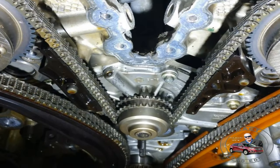We had no lead and we had no tin. So overall, there was no damage to the bearings or to anything else that was on that engine as far as the needed stuff. This metal came directly from the water pump, and I'm going to show you why, where we got the metal. And if you look at this picture I'm posting up right now, you can see the metal that was gathered up on the oil pump itself. Check that out. That's right, this thing ground itself to death.